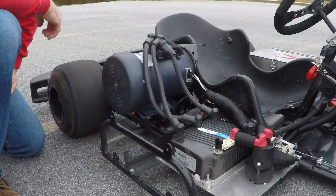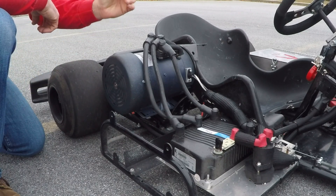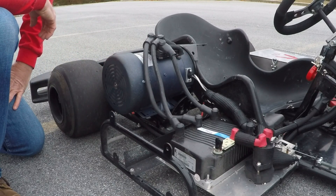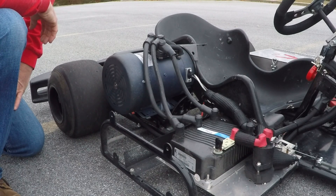Let's start with the first of our three main components of the bolt-on kit. The first is of course the electric motor. This is our 48 volt alternating current, or AC, electric motor. It is capable of 27 horsepower and 65 foot-pounds of torque at 2200 RPMs — a very powerful motor rated at 600 amps of current.